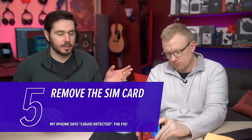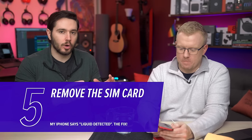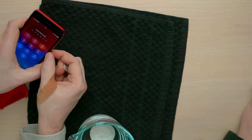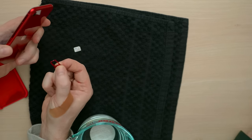If you dropped your entire phone and it got totally submerged, we also recommend removing your SIM card. The water could damage your SIM card and then you'd have no service. Also, opening up that SIM card tray gives more ways for the water to escape your phone. That said, I wouldn't do this unless you were sure there was more wrong with your phone than just needing to set it out for 30 minutes.